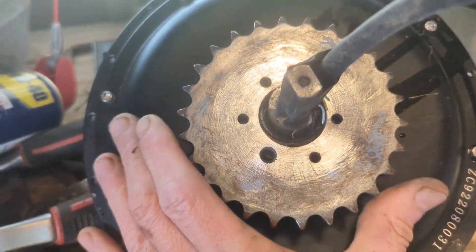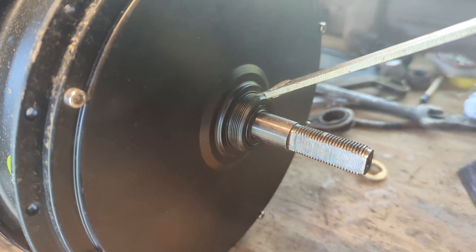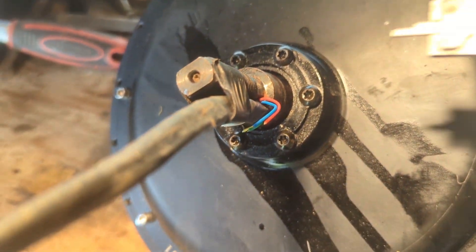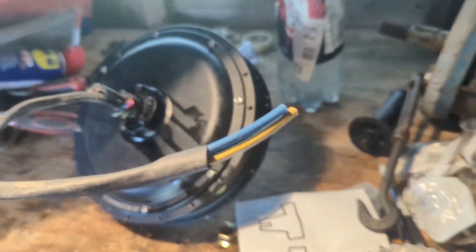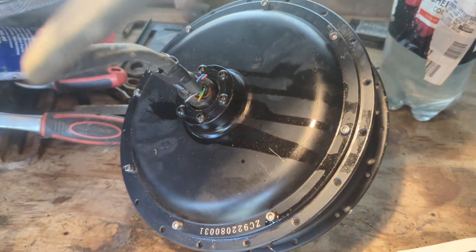With my design the gear cog goes on the front of the motor. I'm still working my head around a couple of bits — it's obviously a lot wider. We've got a bit here which would be where the rear gear cassette would fit on, and then this is kind of wasted space here, which means the frame has to be bigger. The all-important gear hub will bolt on where the brake disc would go, and again the spindle will stay fixed. The other issue I've got is with the wires — I was stupidly hoping the wires would come out of the middle, but because the wires are thicker than I was expecting, the wire wouldn't fit down the middle.